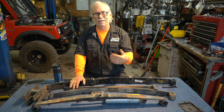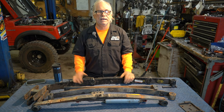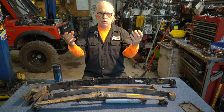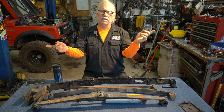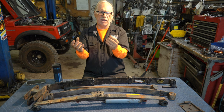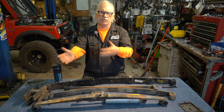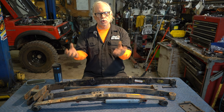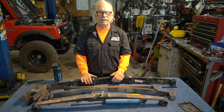All the YJ kits are a ten because it's the long wider spring. To do YJs you have wings underneath the frame behind the driver position — these are for the big eye of the factory springs. The big eye means the big bushing; the small eyes go out on the ends. Everyone doing YJs has to bolt on anchors for the axle to the frame. I'm going to weld mine on even if it says it's a bolt-on kit, and you should too. You do the shoes which go over the wings, drop the bolt, pick up some length, and get some lift.